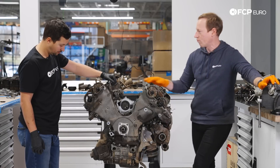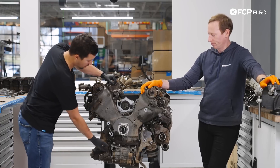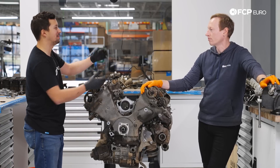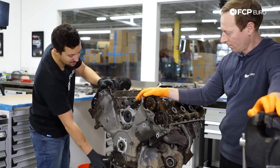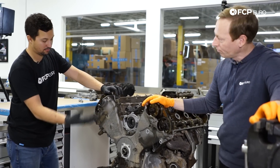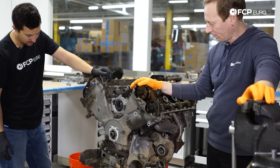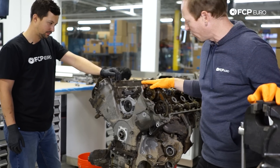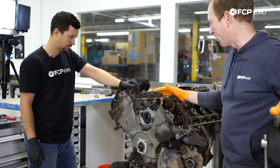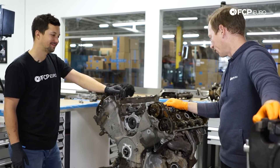Because of the way it sandwiches together, this particular unit is very difficult to service while the engine is in the car. Originally I thought, oh, it's the oil filter housing, like those BMW engine oil filter housing gaskets — but not really. This is built into the actual oil pan, the entire sump — a part of the engine itself, not just a secondary thing. So we'll pop this timing cover off, start to expose some of that stuff, and go over a few things here and explain why this is better than most Audi V8s probably.